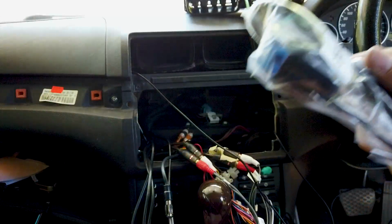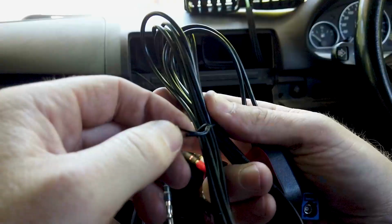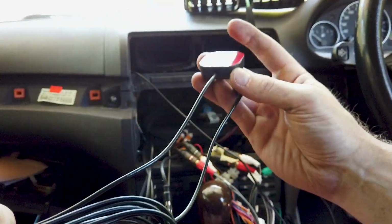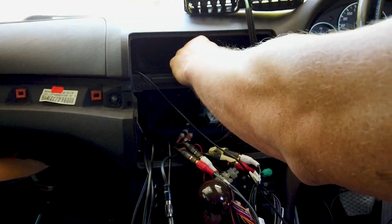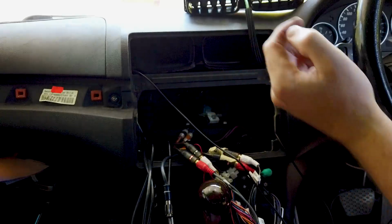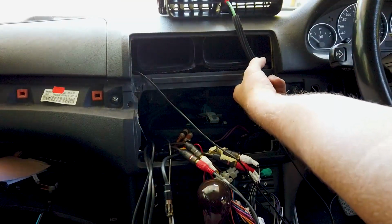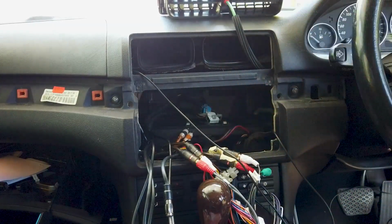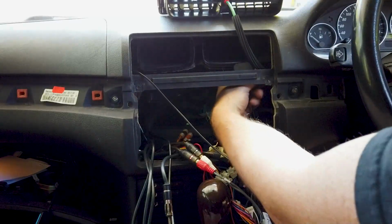And then you've got your GPS antenna, same thing, it just needs a clear view of the sky through the windscreen with no steel above it. Normally you can stick it up underneath the dash somewhere. Sometimes it can go up on top of the air vents, but it's a bit tight in here. Oh, there's a good little spot on this side. If you fit your hand in there, you'll feel there's a flat little bit underneath the dash. So stick it up under like that. I like when there's a good spot to put these things, it's always handy.